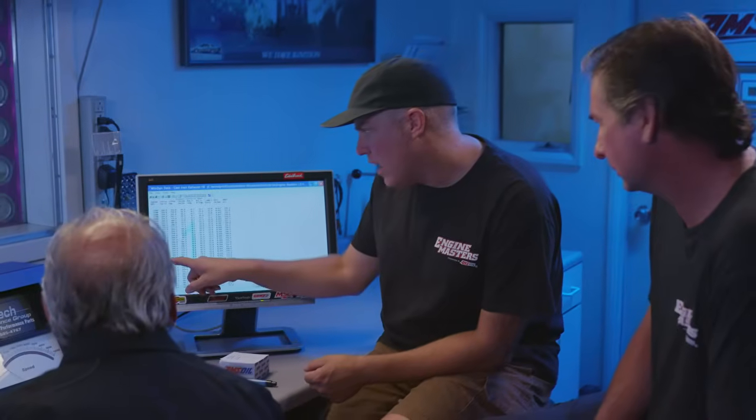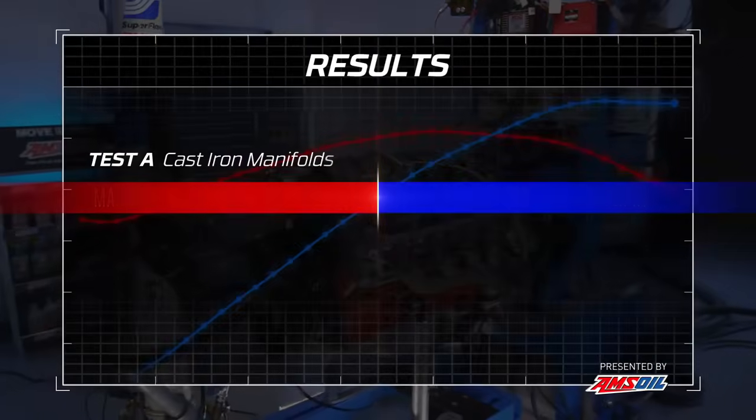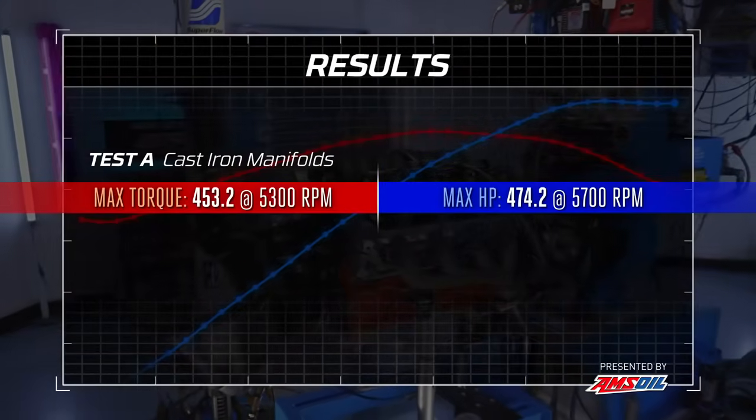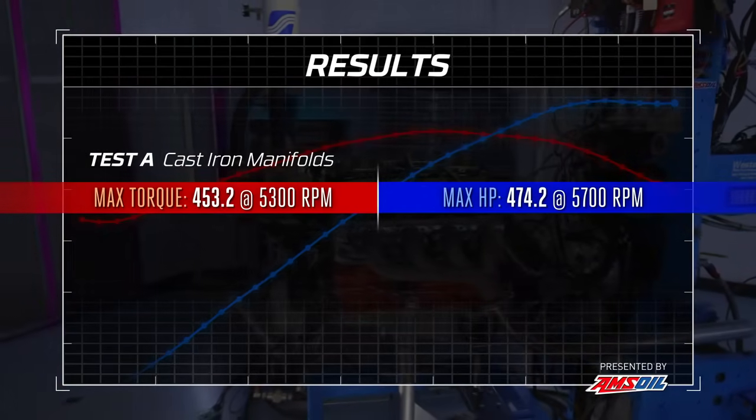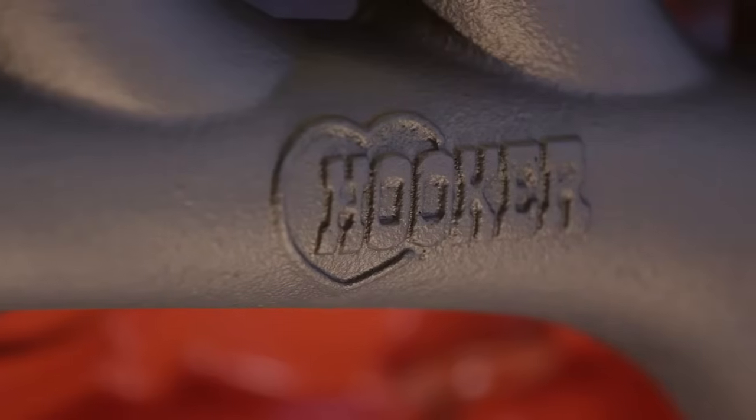So we're looking at 400 and basically 50 pound-feet of torque and 474 horsepower at 5,700 RPM. So that's not magical, but pretty good. Yeah, but consider it's exhaust manifolds too. I know, that's actually pretty cool. We're used to running everything with headers. So, you feel pretty good about that number? We can use that as a base? We can poke around from the tuning I had done earlier. I mean, we're within 2 or 3, so it's right where it was. Okay, well, that's all we need.